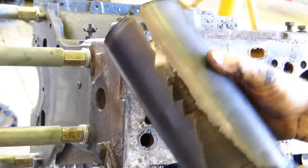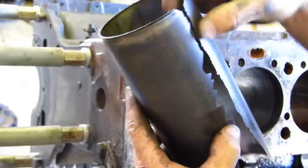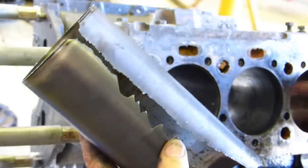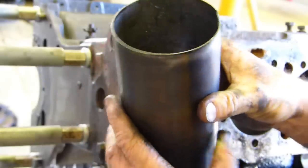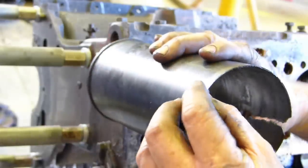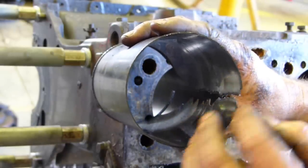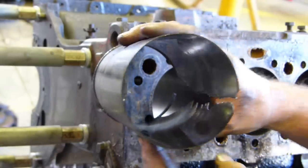And look, that's one way of doing it. I tried welding the top one, but I actually welded in too far, and I've got a little mark up the front here I've got to tidy up, so that's why I went to the old screwdriver method, because they're only very thin here, and it's not hard to weld too hot and weld through them. Not that the weld sticks to the cast very well, but anyway, that's one way of getting them out.